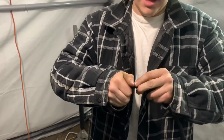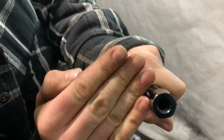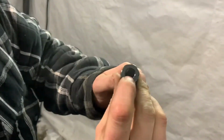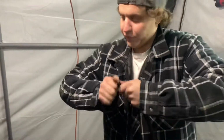So you put it onto the line, and then yeah, it's starting to go on. You'll see, not sure if you can see in there how far the line is from the step where those small threads are. It's really hard to explain this AN stuff. And I'm done twisting it. I just had a little bit of trouble with this one. And now you can see it is very close. Can you get in the light, maybe? Yeah, I can't really see all that much. Anyway, the rubber line is on the step part before those threads. Now, yeah, reverse thread onto there.